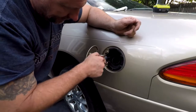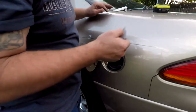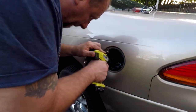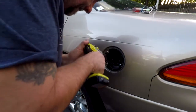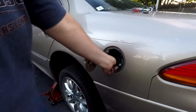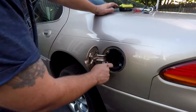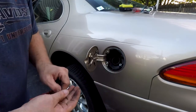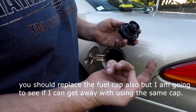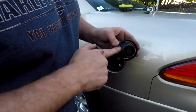The plastic fill-in-neck cover here — the holes don't line up, so I'm just going to have to drill some holes in the plastic. I had to make two holes because the holes from the factory did not match. Got to get the gas cap on — I like to put a little bit of silicone base grease on the seals. That just helps them to last longer.